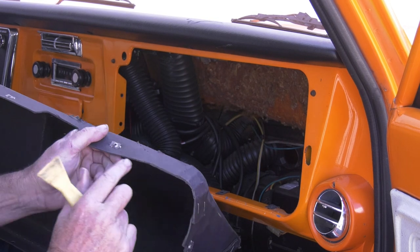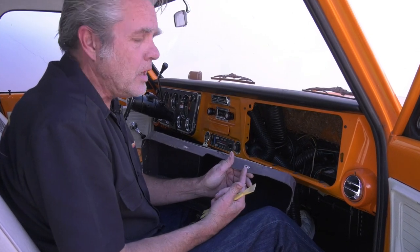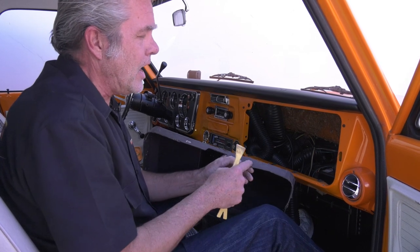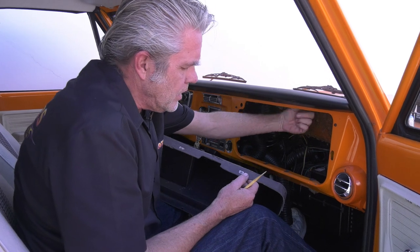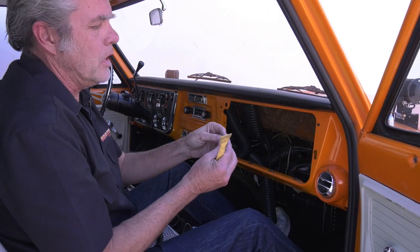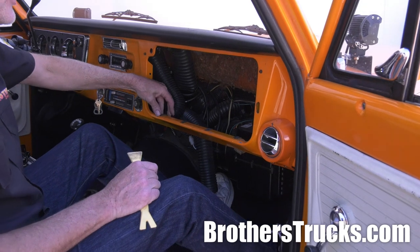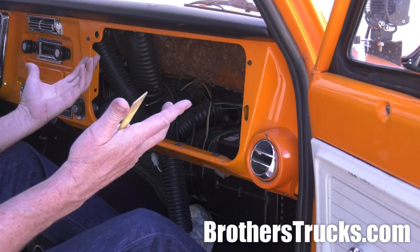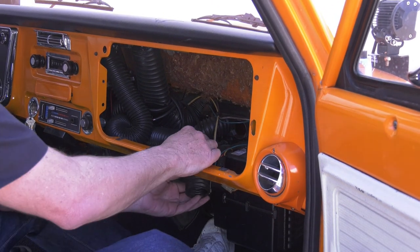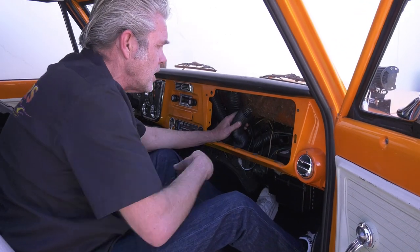That's how this comes out. Sometimes these stamped nuts will just break off and keep spinning — if that's the case, it's not holding the glove box anyway and you should be able to get it out. After the glove box is off you can get underneath, hold it down with pliers, and take it the rest of the way out. On the bottom you have slip nuts — called that because they just slip right on — and sometimes those will break and spin too, so be prepared. It's not a big deal; you should be able to get the glove box out anyway.